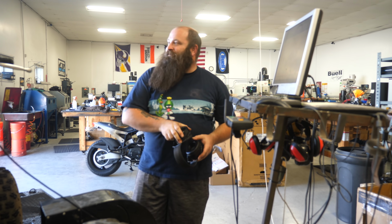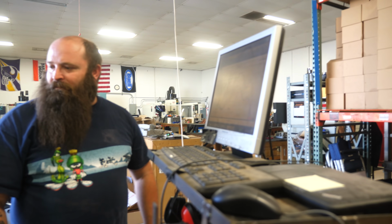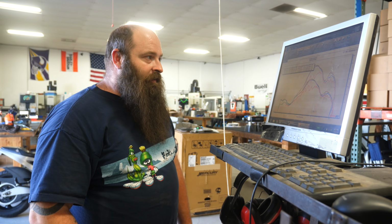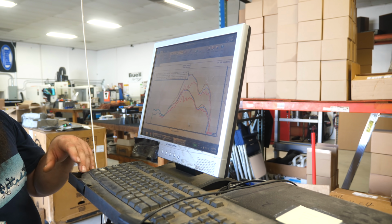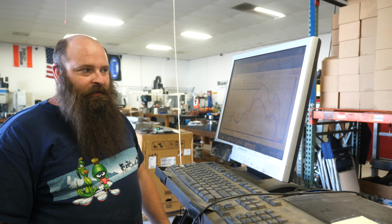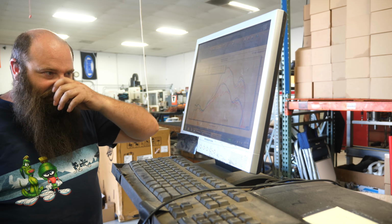There we go. That looks like a dyno chart. Yeah, we got that inductive pickup problem figured out by the ultimate process of trial and error. So that looks a whole lot better, and very consistent too. We're at around 22 to 27 foot-pounds and 32 to 37 horsepower, all right about the same spot.